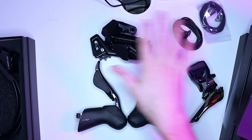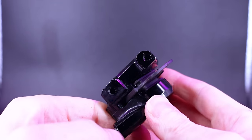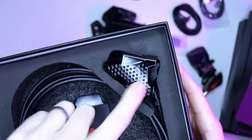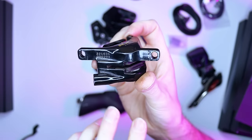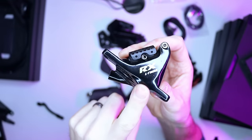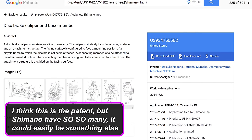The first thing that struck me when I opened up this groupset wasn't the shifters and derailleurs — it was actually the brake calipers. They look very, very standard, and that's interesting because they follow the standard Shimano flat mount design. This is a similar caliper to what you'd find on any Shimano groupset. L2 with their hydraulic groupset avoided this approach, so let me grab an L2 brake caliper to show you the difference. This flat mount caliper from an L2 hydraulic groupset has wings on each side rather than the two narrower holes in the bottom of a standard flat mount caliper. They also include slightly odd-looking adapter plates so you can fit these calipers onto the frame. From talking to L2, they adopted this approach because Shimano own a design patent on that slightly narrower bolt spacing on the bottom of a flat mount caliper — so they designed it this way to avoid any legal trouble.